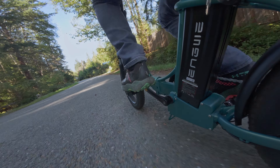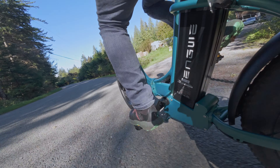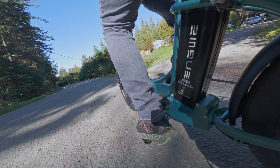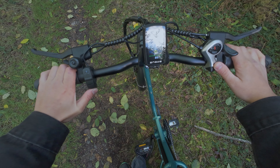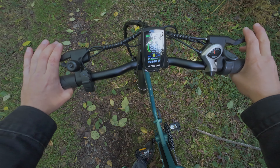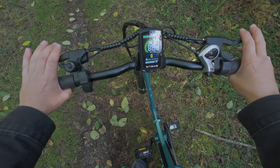A lot of e-bikes have wider tires, and what happens is if your battery dies or you're pedaling long distances, there's a lot more traction and that means a lot more resistance. The wheel on this bike is kind of in between a regular bike wheel and a fat tire wheel. It is technically a fat tire but on the narrower side, which gives less resistance on the road, but it's also wide enough that when you hit bumps, gravel, or have to go off the pavement you can handle those things — unlike a really thin-wheeled road bike. It's kind of that perfect middle ground for tire size.